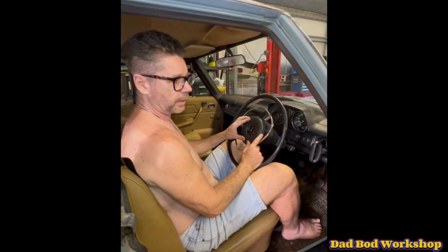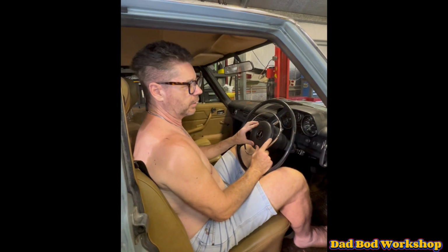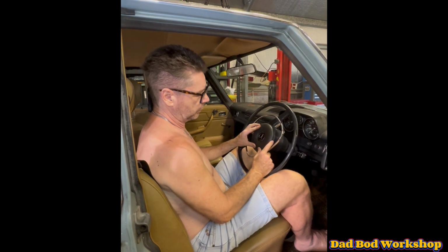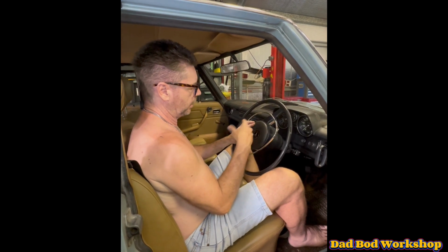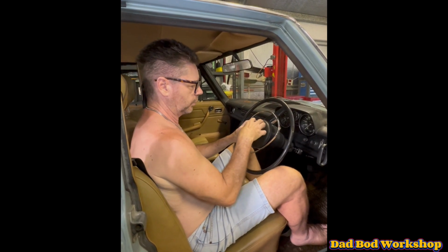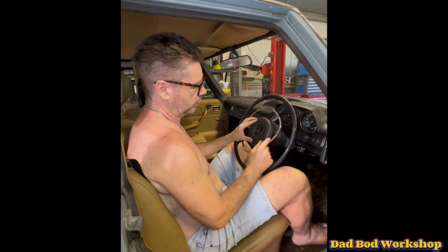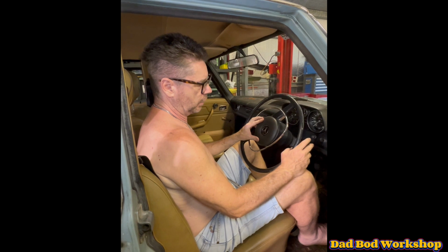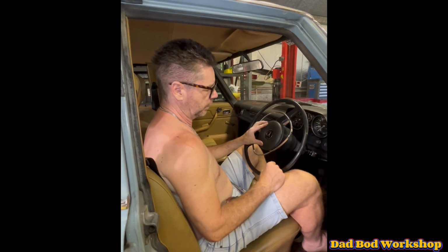When you put the coupler back on, sometimes the steering box spline and the steering column are out slightly. So you need to just center your wheels and bring it under your steering wheel, take it off and reposition it so it's dead straight again. Just have to be careful, if it's too far out, the return on the indicators isn't going to happen. So you'll just put the steering wheel back on straight and see how we go.